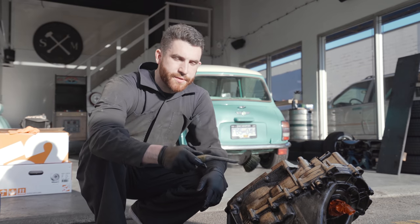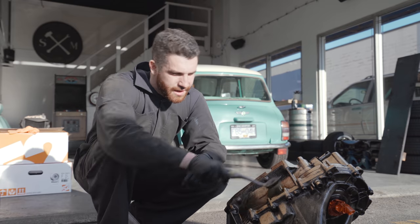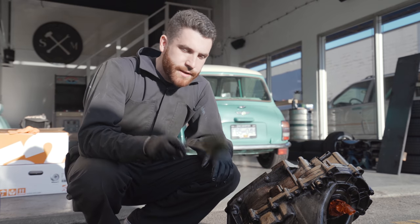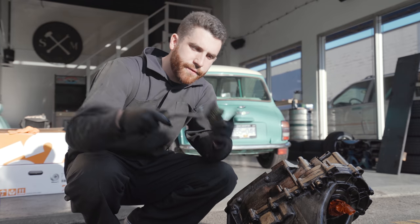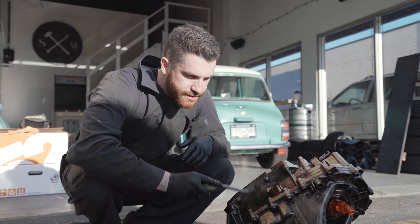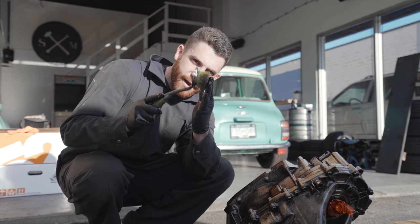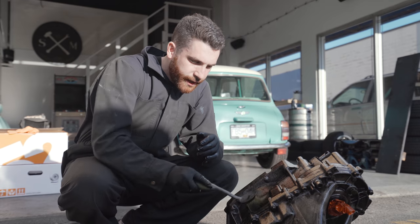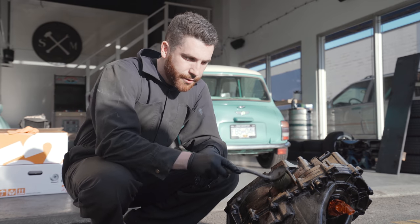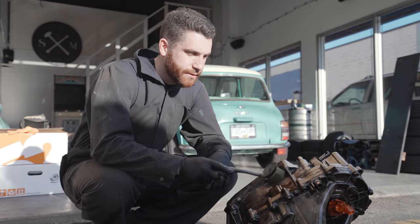Here's a little tech tip when it comes to scrubbing and cleaning things. A lot of people make the mistake of scrubbing really hard with the brush, thinking it'll take the dirt off better. What we've noticed after many years of doing this is that in order to scrub things best, you want to do really light strokes. The second you push hard enough to bend the bristle, you're actually scrubbing with the side of the bristle, which has no abrasiveness. If you go really light and use just the top of the bristle, you pull contaminants away from the surface using the rough edge. It works much better than heavy strokes, and it also saves your brush. Any dentist will tell you the same thing.